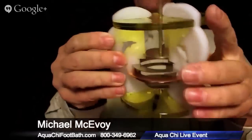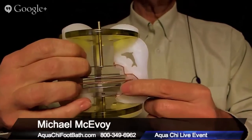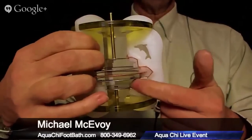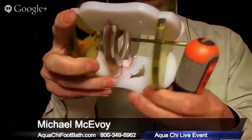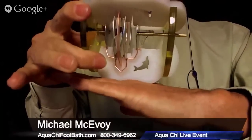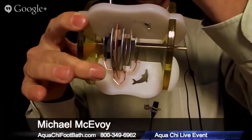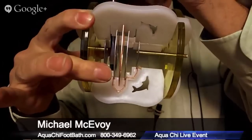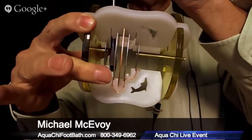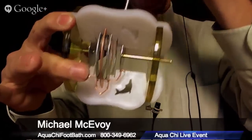Once you've got it back in, I like to check and make sure that the silver ring on either side of the copper ring is fully seated and up against this copper strip in the leg. The easiest way to do that is to place this part of the module on a table, then take a flathead screwdriver and come in pushing down on the silver ring — it's going to take some pressure to make sure it's fully into the leg. Do the same thing on this side, and then you're good to go.